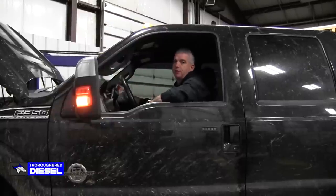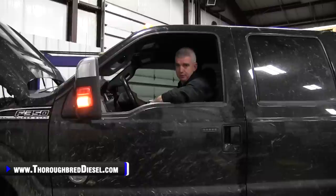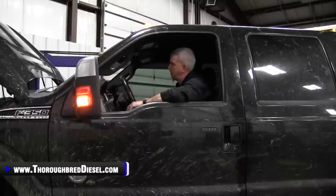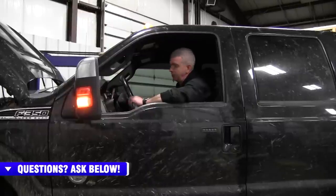Next, no check engine lights, everything looks good. What you want to do is you want to cycle through the gears. So go into reverse, feel like it's pulling in reverse. Go to neutral, does it feel like it turns loose? Drive, does it want to pull itself forward? So you cycle through all the gears first, down into manual, drive, neutral, reverse, and go back to park.